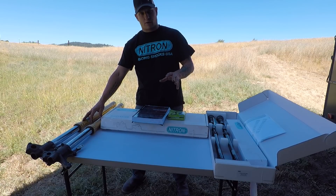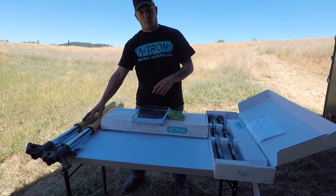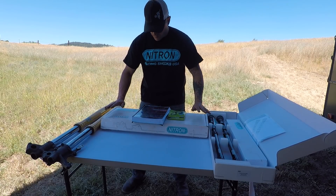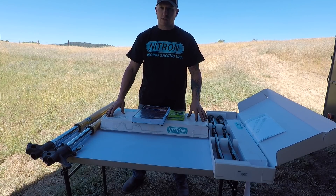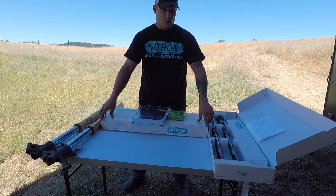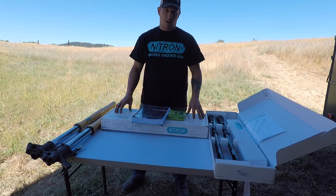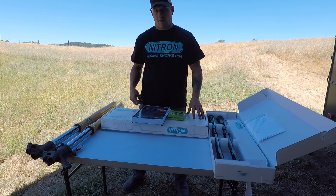I haven't done a video to show how to take those off, but they're pretty self-explanatory — just release the pinch bolts, remove the front wheel, they pretty much slide right out. Here I've got my Nitron Toolkit. Unfortunately there are a few specific tools that you have to have to be able to install these into the forks. Depending on how quick you can do it, sometimes you might be able to get a loaner kit from Nitron themselves — they might be able to send that to you. And if you don't feel comfortable, we can always bring it to a local shop and have them do them for you.